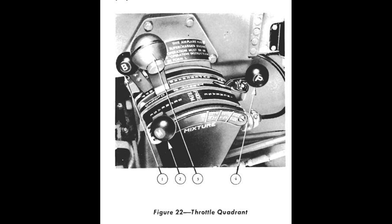The way it works is pretty simple. Full forward gives you maximum RPM, meaning that as you advance the throttle from idle, the engine RPM will accelerate towards redline. Once it reaches redline, the propeller pitch will increase to prevent it from going any faster and effectively harness the power from the engine. When you pull the throttle back, the pitch will decrease. This is called a constant speed propeller — it varies the pitch to maintain the selected engine RPM. So for our purposes right now, we're leaving it full forward: max RPM, max power.